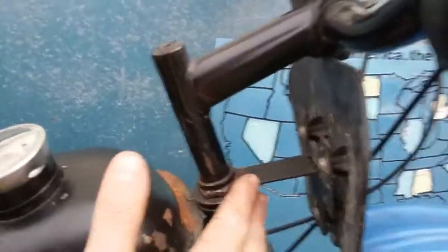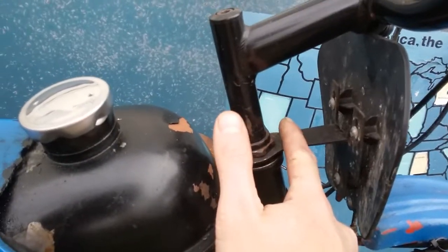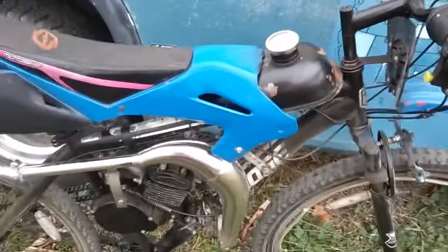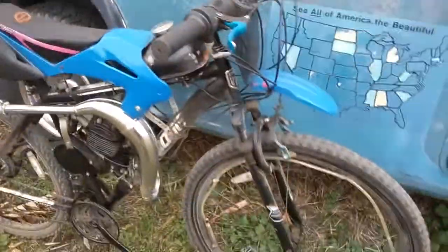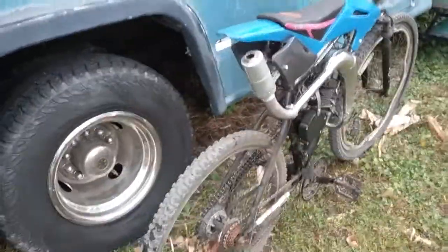It's wrapped around the frame and then goes to the plastics to secure them. For the front it's pretty easy — you just take this apart and slide it down, but you might have to dremel or file it out if it's too narrow for your headset. This is a 29-inch bike, and the stems are different on 29-inch bikes compared to 26-inch bikes in most cases. It's a narrower setup, so you may have to file it out, but I didn't have to.